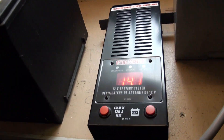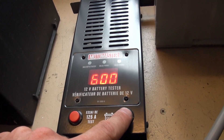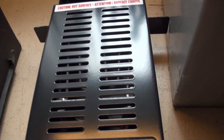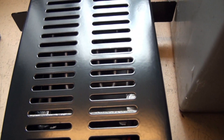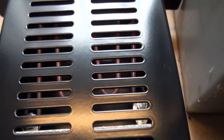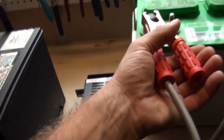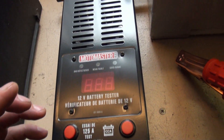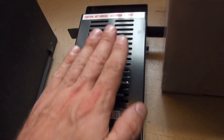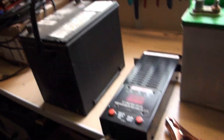The load tester is hooked up and we're reading 14 volts — that's very good, but that doesn't mean anything on its own. I'll select 800 cold cranking amps and run the test. The voltage is dropping and I can feel a tremendous amount of heat. Under load the voltage dropped to 11.4 volts, but it was still able to deliver a proper amount of capacity to turn the wire red-hot. This thing is really, really hot right now.